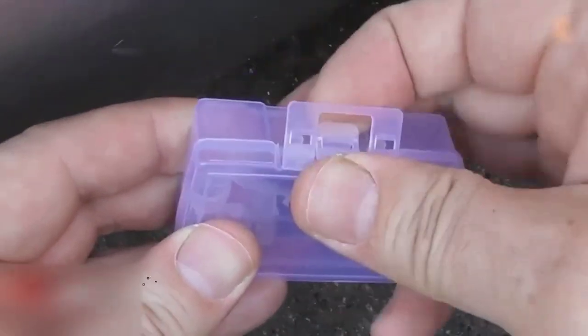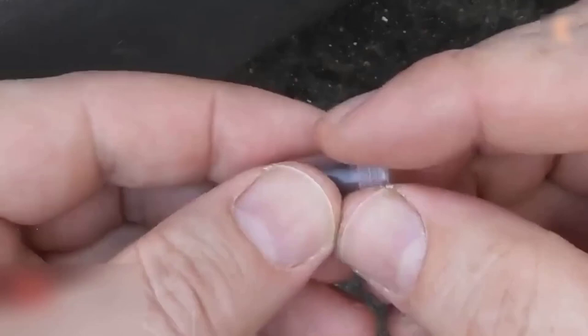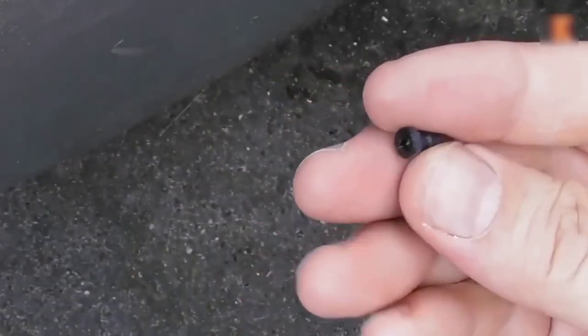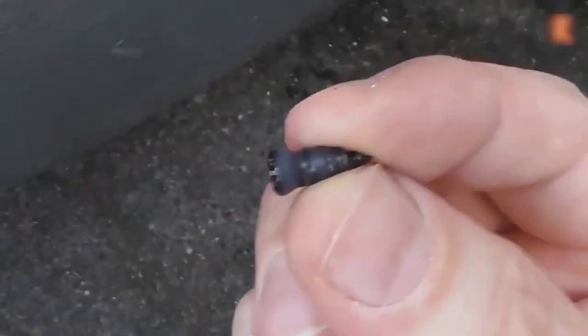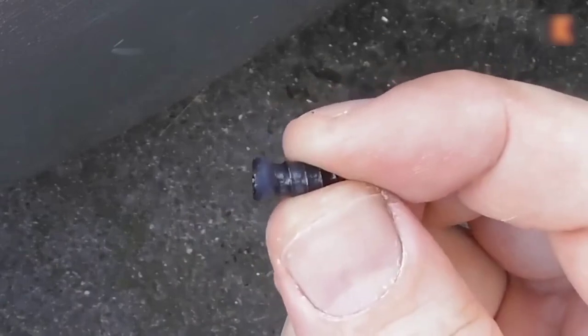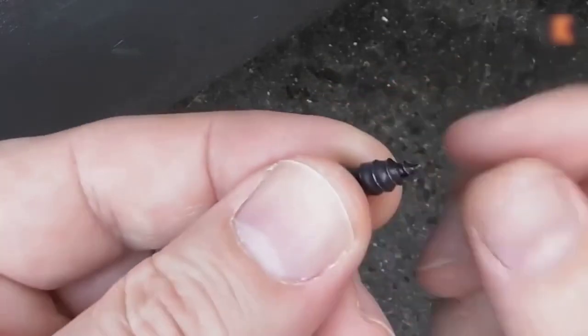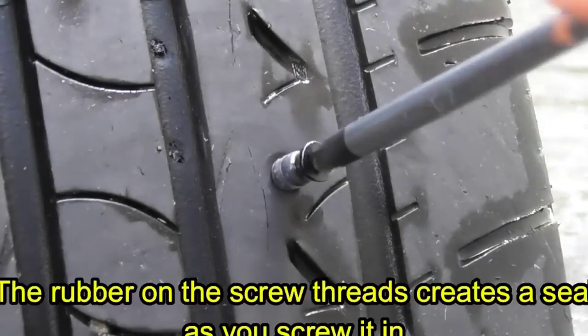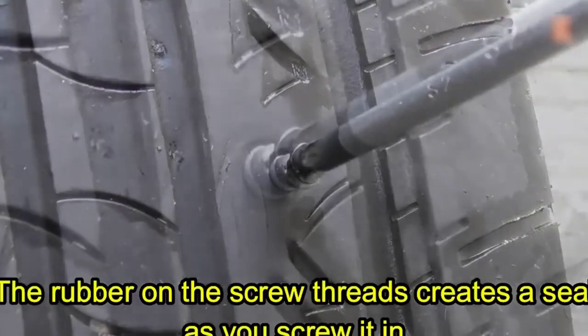Introducing the mini tire sealer for sealing the tire in the event of a puncture. As funny as it may sound, but these self-tapping screws will really help you in case of a puncture of a tubeless tire. And it is the fastest and easiest way, which does not require special skills and tools. The thing is that they are covered with silicone, which gives good air tightness. It is enough to screw a self-tapping screw into the resulting hole, like a nail, and continue.